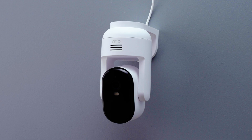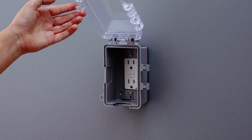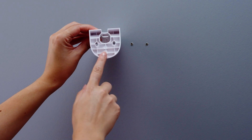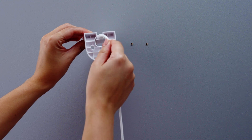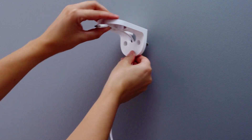Now that you've got the perfect spot, the Arlo app will ask you how you want to install your camera. If it's going on a wall, you'll want to use the L bracket. Before you screw anything in, take a moment to figure out where your nearest outlet is. If it's below where your camera is being mounted, feed the power cable through the channel in the back of the mount. Make sure you have a bit of slack so you can easily plug your camera in later. If you'd prefer that your cable comes out the top of the mount, you can skip this step.